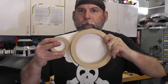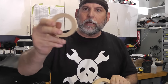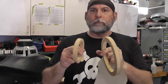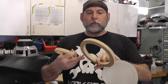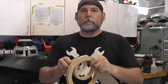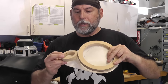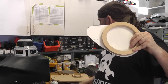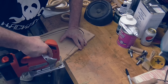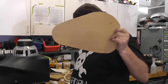So let's say this is what I want my speaker pod to look like, where the rings represent the speaker. By the way, these are MDF rings — you can buy them pre-made. I use a lot of pre-made ones, but then I make rings from them and use them more as templates, because ultimately I screw them up and have to buy more. You can cut them out with circle cutters using your router, or you can do it with a jigsaw — I'm going to use a jigsaw today.